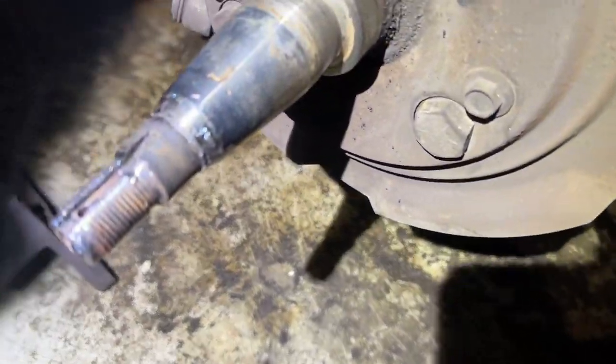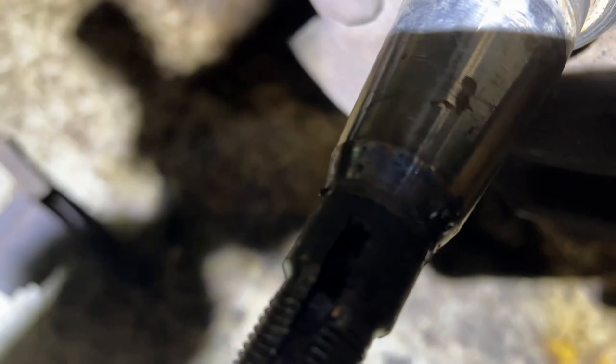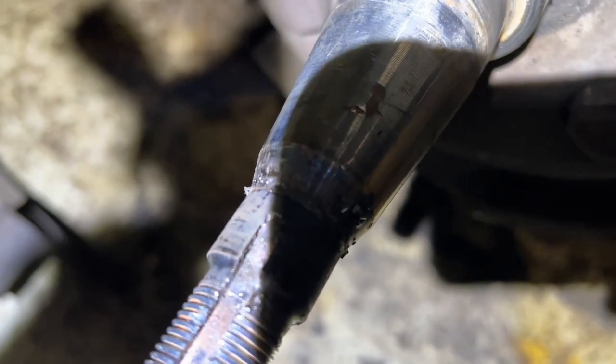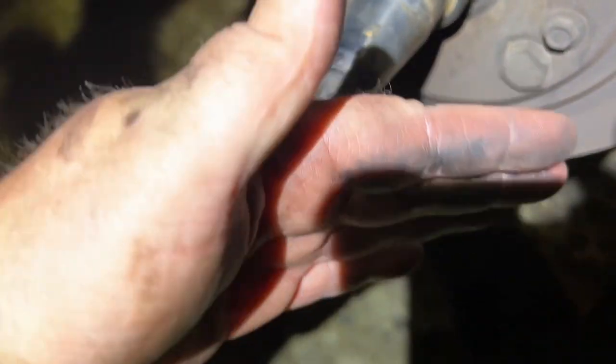Just so you can see — I didn't damage it. There are some little scuffs there, but that's not from me. I don't know if that's called an inner race, but it's part of the bearing itself, and it did some damage there because the rotor was flopping.